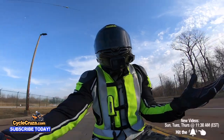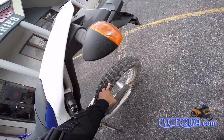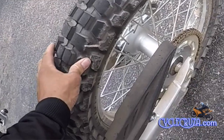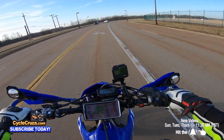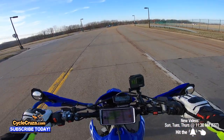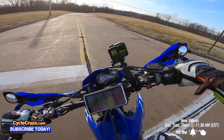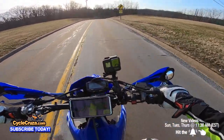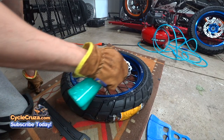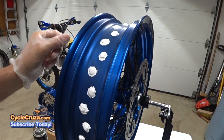That is the biggest drawback to a dual sport. I experienced it — I got a puncture in my tire when I was out in Colorado in the city. Luckily it didn't hit the inner tube, otherwise I would have been stranded. It was at that point I was like, we've got to think about getting something else. That's why I wanted to step up to the 450 and get 17-inch wheels with ADV tires that have the grip to go off-road, but I can make them tubeless and patch the tire if I ever get a puncture.